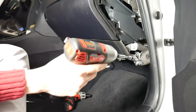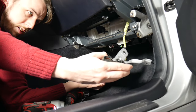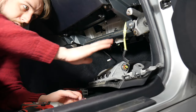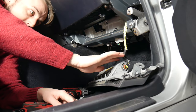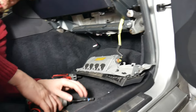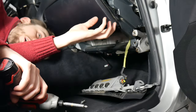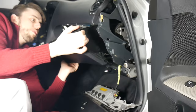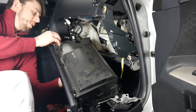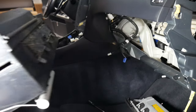Now that that's removed, we've got some 10mm bolts we need to take off. We've got three 10mm that hold the airbag in place. Don't mess with this connector or any yellow wiring or loom — it's all for airbags. Make sure you have the battery disconnected if you do have to mess with those connectors. We're going to leave that to the side and take out these two. Lastly we've got some Phillips head screws here that we need to take out. We'll pull the glove box down — there are two clips up top that we need to remove — and that's how you remove the glove box.